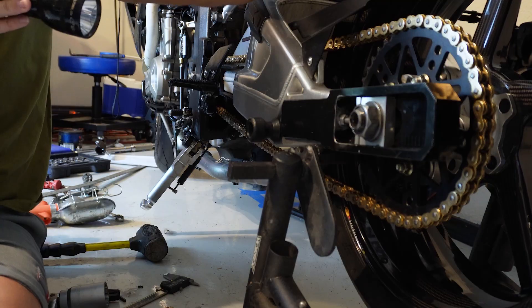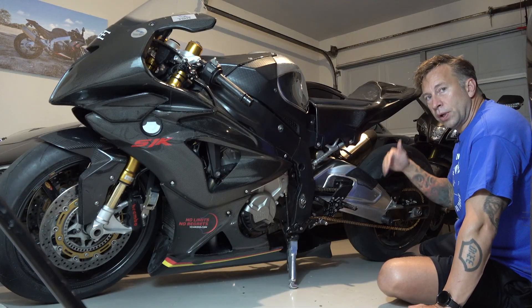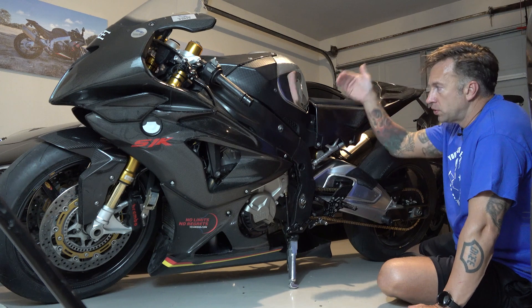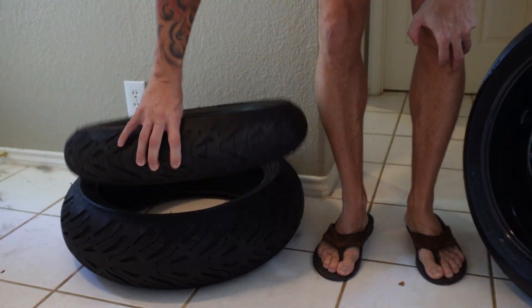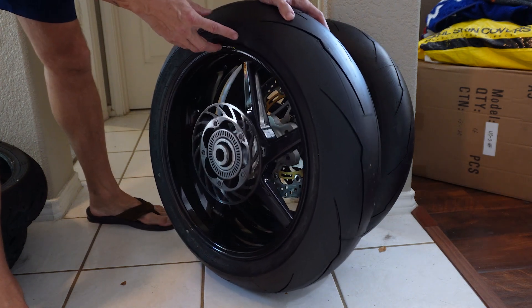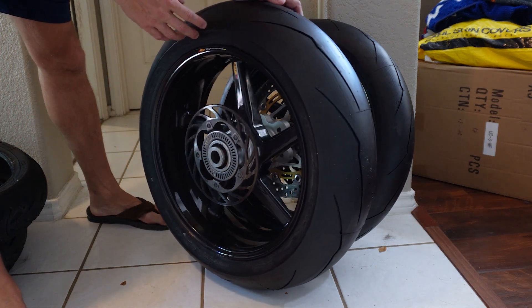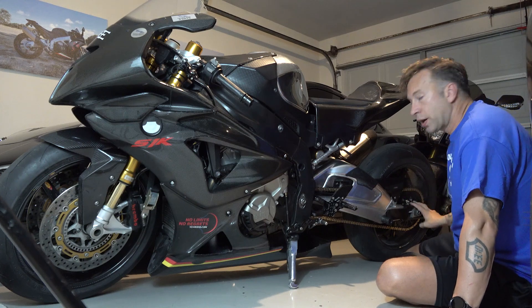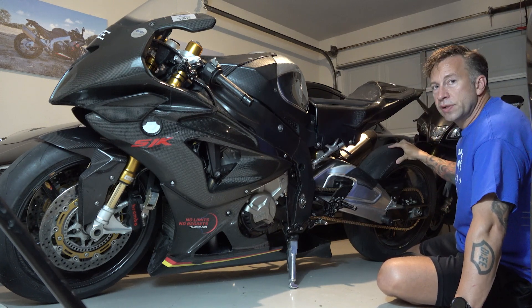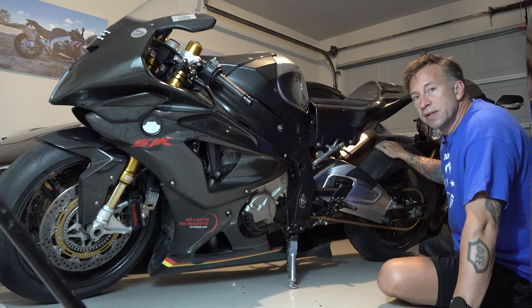That's what I had on last year, and I brought along the 43 and the 42 sprocket. In case I maxed out at the 44, I could adjust to the 43 and 42, because in the Texas Mile and events like this it's always better to start at a lower speed max and work your way up — if you start too high, you'll never have the torque to get where you want. I also replaced the Michelin Road 6s on front and back with the Pirelli Supercorsa Diablo V3s, which are supposed to be a lot lighter and stickier. I thought if I fix the wheelie problems with the swingarm extensions, the next problem might be that the tires slip. So lighter weight tires, less rotating mass — especially combined with the carbon fiber BST wheels — and sticky to get as much grip as possible.